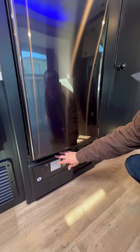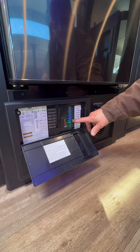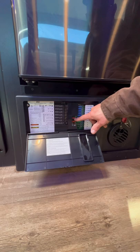Down here is going to be your power distribution panel. Here's all of your 110-volt side, and this is all of your 12-volt side. If you have a 12-volt fuse that blows, it'll have a little red LED light over here to let you know which one has blown. You'll need a 30-amp and 15-amp fuse — that should take care of anything you have in here. These are reverse polarity fuses. If your battery ever gets hooked up backwards, it will blow those fuses to keep from damaging your converter.